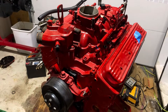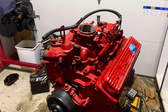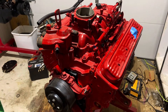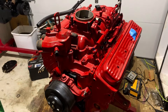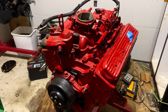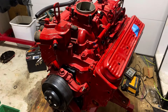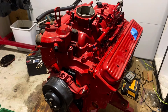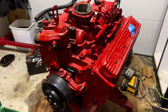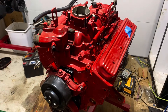The injector part numbers for the 5.0 and the 5.7 for this particular style of engine are the same. Since the injector size is big enough to run a 5.7, the injectors are held back by the computer to run a 5.0. So you don't have to change injectors — you just have to get the computer reprogrammed so that it knows it's running a 5.7 versus a 5.0. There are several companies across the country you can send it to, and for $500 they will download a 5.7 calibration instead of a 5.0.